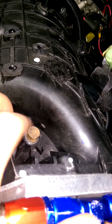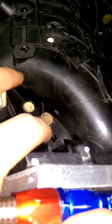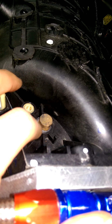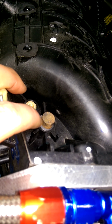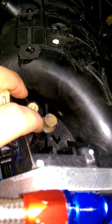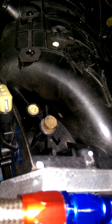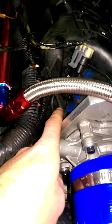So I left it there. Also, you're going to plug the top of this with something. I just, again, machined up a scrap piece of steel. I'd prefer it if it was aluminum, but at the time I couldn't get a hold of any. I might pull that out later. I got some scrap aluminum laying around now. I might pull it out later since it's rusting, but I just took some RTV sealant and I milled that down real close. I think this is 1/2 inch stock. I forget what diameter it was. I think it might have been like .480 is what I made this. Or maybe a little smaller, maybe it's .470. I think this major diameter was .480. So there's 10 thousandths of clearance overall, so I just stuck some RTV sealant in there and said fuck it. So it held.